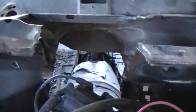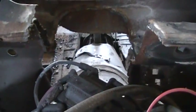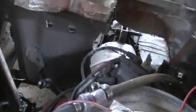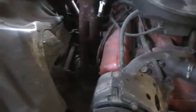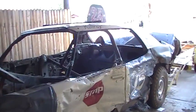See my giant hole in the firewall — I did not want to break a distributor. It won't take that much strength away when you've got a good door dash bar in, but there's really no way to get the distributor cap out otherwise. You can make distributor protectors but they can even bend, get jammed against the firewall, and if you have to change the heads it's a pain. That's why I quit running one. Changing the tranny is also a pain, so I pretty much don't do that anymore. Headers are still fine — finally got a small dent in them after all these years. Hope to get her scrapped here soon and start welding on the frame for a better car next year. See ya.